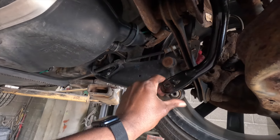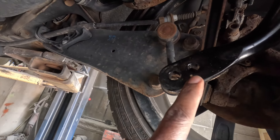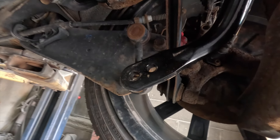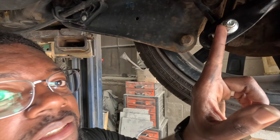After the end links go on, you've got two settings. I believe this is the softer setting and this is the stiffer setting — depending on where you put it, that determines how stiff the rear end feels when you turn. I went with the stiffer setting. This here would be the looser setting, and this is the stiffer one.